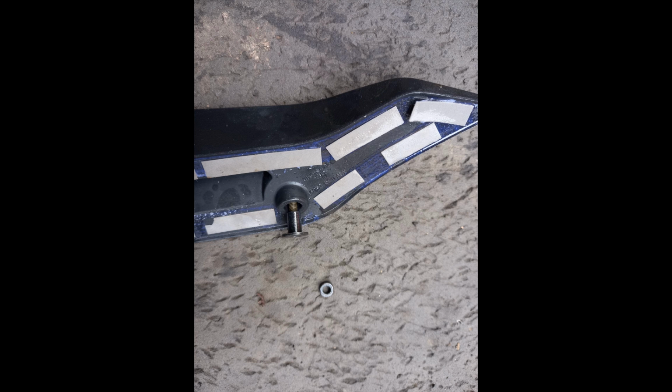One of the things which that did show me, because I had them fitted by the dealer when I picked the bike up as new, is that if you do want to fit them as an aftermarket accessory, they're really super easy to fit. It's literally just undoing one bolt, peeling the backs off the sticky pads, putting the bolt through, and then sticking it and positioning it, and that's it. It's nothing more than that. So if you do want to fit them, don't feel like you have to pay dealer installation costs, because they are super easy to fit, and it is an easy DIY job.